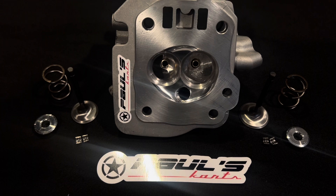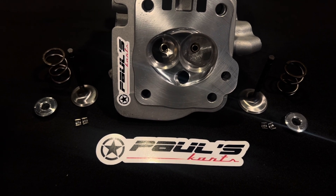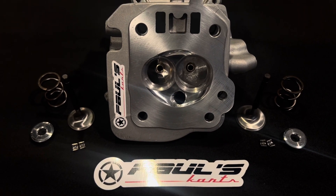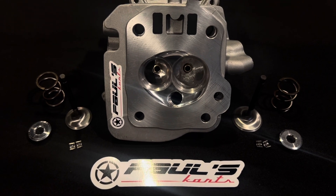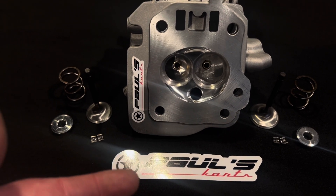We do the equation for CFM based on those figures. It's cubic inches times RPM times 0.00094, divided — we work the full equation out. That gives us the CFM requirements, and for that we've already have all of our pre-sized ports with dimensions measured.